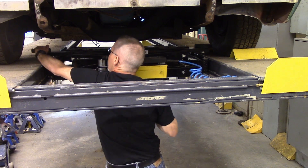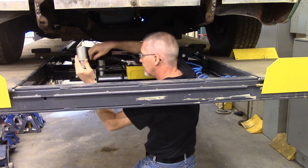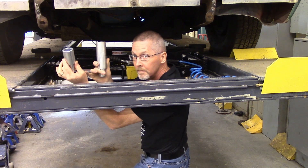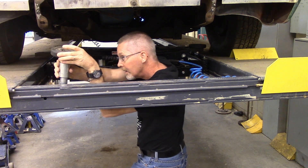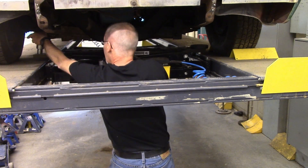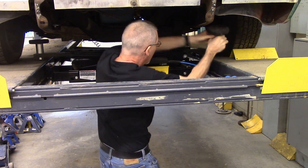Look at it. Watch it. This is a trolley jack — we have two trolley jacks so you can raise the vehicle and get the tires off. Position it with whatever extenders work best for you to get those little pads as close to the wheel as you can, usually on a control arm near a ball joint or a kingpin, or sometimes if you're doing suspension work, on a frame. Kind of depends.